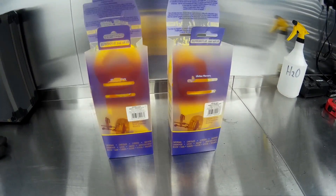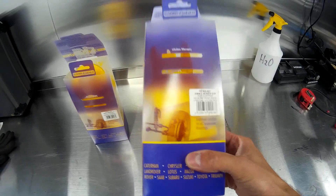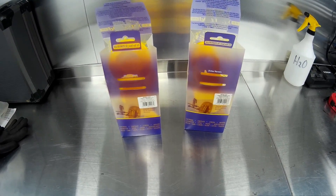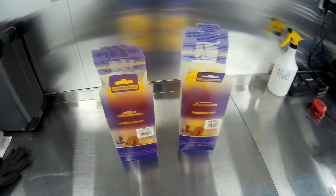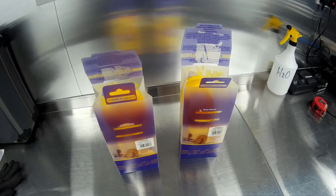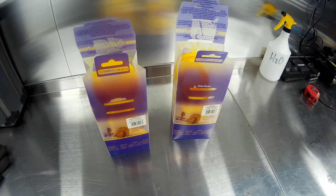Welcome to another how-to video for the BMW E39 M5. Today we're looking at the rear subframe bushes. I recently did a complete suspension overhaul on the M5 which included all new rear arms, bushings, ball joints, thrust arms, and various poly bushings using PowerFlex items. After refitting the subframe and doing the alignment, the work cured the severe axle tramp I was getting when making a sprint start, though a slight bit of axle tramp remained.